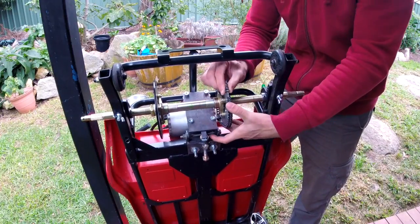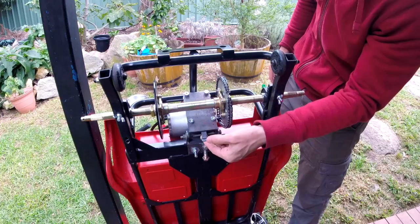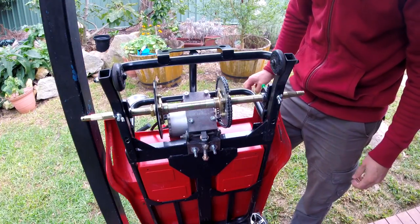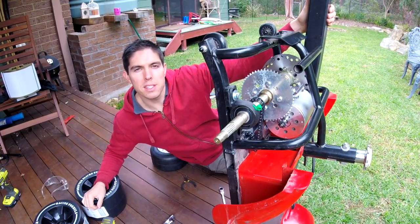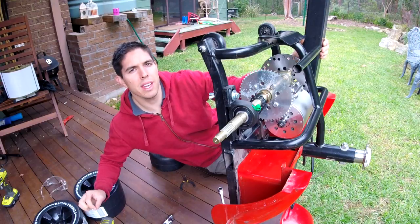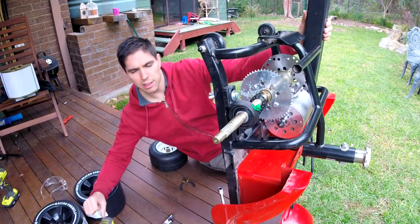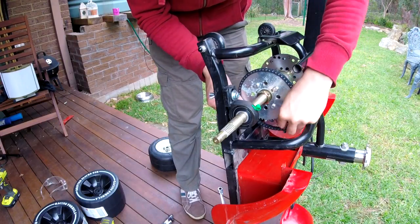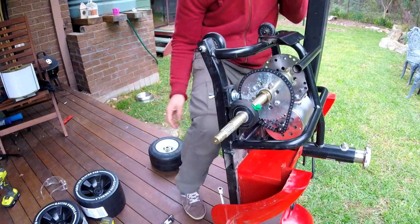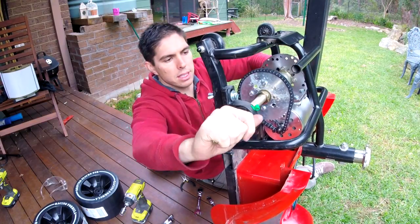The chain does fit, however I've decided to add two more links so I can move the two sprockets further apart. I have the tensioning bolt which I can twist up to push the motor away, and a second locking bolt to stop anything vibrating loose. I was sold a chain tool that only breaks chain and doesn't connect it back together, so I had to use a pipe and hammer to very carefully snap the pieces back on. I do have a master link on the way, which will make this job much easier. With the chain reconnected, I put it over the large sprocket and get it over the small sprocket on the motor. It was far too loose, so I used the tensioning bolt underneath to fix that. Motor can no longer move, chain has tension, everything's clear and aligned — I think we're ready to turn the motor on.